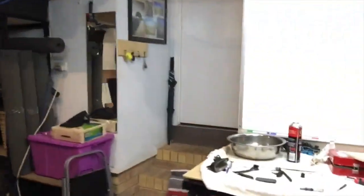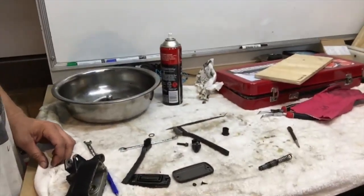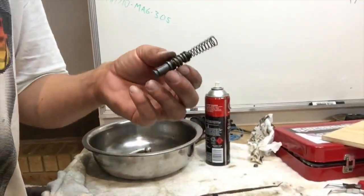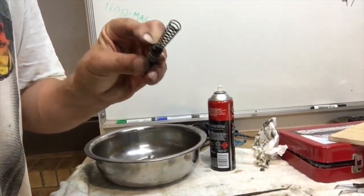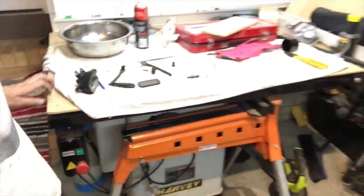I've just been playing with a few other things on the bike — I've taken the brake lever off here and dismantled it because it wasn't working. I wanted to bleed the brakes but just couldn't. Turns out the little rubber washers that sit in here aren't O-rings, they're a different type of washer, so I'm just going to have to get a kit for that.